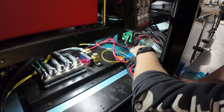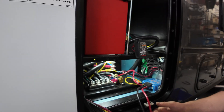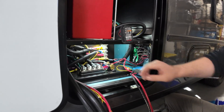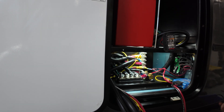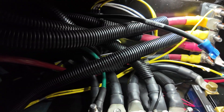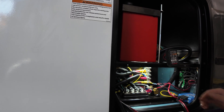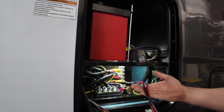It's just two screws to hold it down. If you can get back in here there are another two screws, but two screws seem to hold it down just fine. Then we have these two wires, which are going to connect to the bus bars right here in the system. And then we have this wire on the input side, which needs to connect to the Mercedes battery. I like to run that back and out of the way as much as possible. In a minute, we're going to be drilling a hole so it can pass through the compartment and out to where the vehicle battery is.